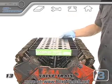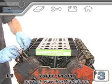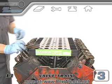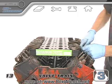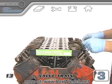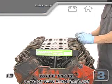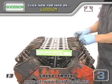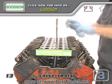There's one extremely important tip to know before you ever pull apart any pieces of the valve train. When the valve train is taken apart, everything has to be organized so that during reassembly, the parts will go back into the exact same positions that they came from. Otherwise, excessive wear will happen if the parts aren't matched back to their original placements and paired with their companion parts. However, this only applies to parts that are going to be reused — if you get new components, they can be mismatched.